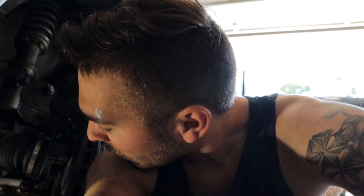Now, I might not be the strongest person in the world, but I think I put in pretty much as much of an effort as I possibly could. What I actually ended up doing was taking the jack and this extension and jacking up the car so that the entire weight of the car was on the back of this hub, and my coilover compressed a little bit so that when I hit the lower control arm, it would be able to knock out freely because you have opposing force going the opposite way. Couldn't budge it. It's been soaking in PB Blaster for almost an hour or two now. That was an issue.